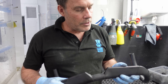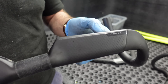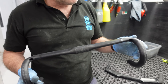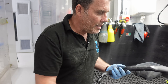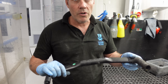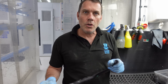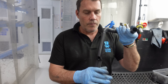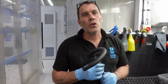With larger tubes it's a lot easier to apply carbon to areas where cracks might be — from a clamp, for example — we can easily repair those. There's a lot more material to work with, so in certain cases we would look at those. In repair, particularly if you can't find those bars anymore, TT bikes — same thing applies. Any fracturing in the junction points, we don't really want to go near them. Generally the thought is: just replace your bars. Same goes for round seat tubes — we wouldn't go near them. Teardrop-shaped seat tubes are different — there's a lot more material and a lot safer to repair.